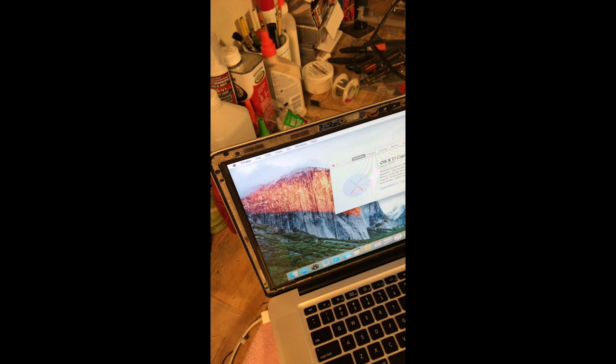And then we'll hit the system report here. On the power, on the battery, you can see right here, cycle count 1, because it's a new battery. It's not fully charged, but it is charging, yes. And full charge capacity, it'll give you that. But actually, it's a little higher than that. It's like 54 or something when it's fully charged. So the battery's working. It should run a lot cooler because, like I said, we did the CPU. We pulled all that off and repasted it and everything. And the Wi-Fi works good.